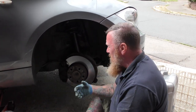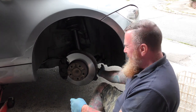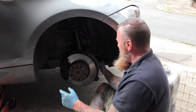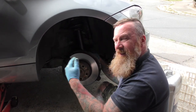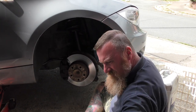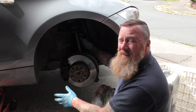It was a real bitch of a job. You've got this arm here that goes to here - you've got to undo that bolt. You've got to drop the belly pan first and then move it away. You've got another leg here, you've got to undo that one - that's a bitch as well. You've got a bolt here that holds the shock on - take the side off, you have to try and get it out. You've got the drop link that goes up and down. You can undo it but you can't quite get it out unless you jack it up.